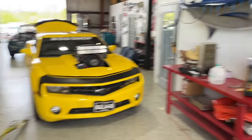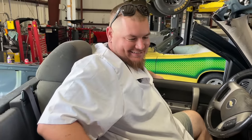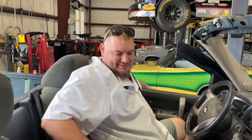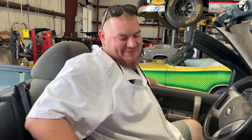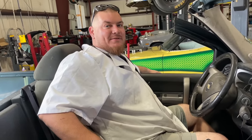Way down in horsepower. Down 30 from our base. Spark knocking bad? That means octane's lower then. Yeah, 229 horsepower. We had, at the very peak, 15.3 degrees of knock. That's a lot. Can you explain knock to them really quick?